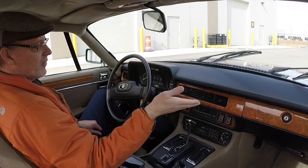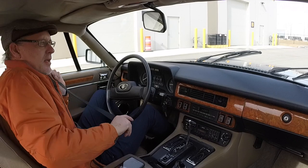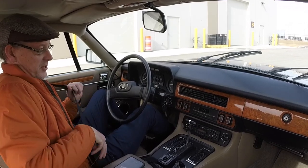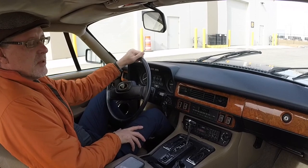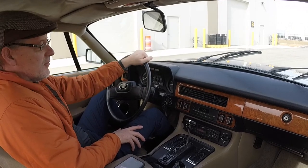So if your AC system isn't working, you're not going to cool your fuel, and it can vaporize. I think in the convertibles, I read somewhere that they just keep the AC on all the time to make sure the fuel doesn't evaporate. They did that because when you have a convertible, you wouldn't normally have the AC on, but you need the fuel cooling.